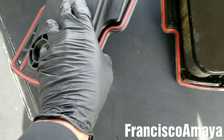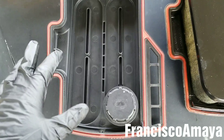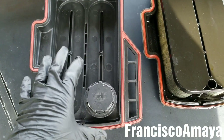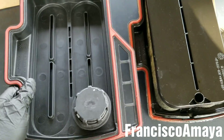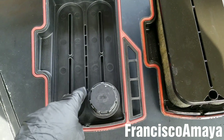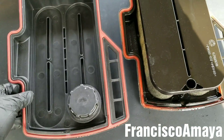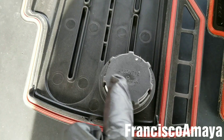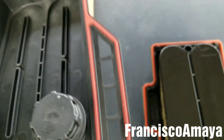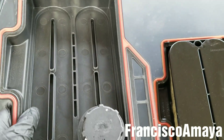You have this little bypass bar. This is a filter you can buy at any store, but some stores don't even know what it is, so you have to take the part number and give it to them. With this filter, you bypass the crankcase — this is the EPA-approved bypass, so you will avoid the high crankcase pressure. It's the exact same size and component as the standard filter, but it doesn't have the thick filtration — it just has this valve. This is the solution for the high crankcase pressure. This will not fix the oil consumption, but it will fix the crankcase pressure.